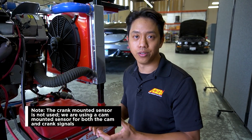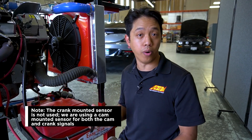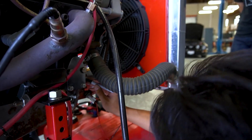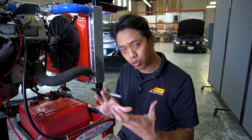One trick I like to use when setting ignition timing on an engine where you can only see a small portion of the crank pulley — making it hard to see where your sync is — is to take a Sharpie, paint pen, white out, whatever, and make additional marks on the crank pulley every 90 degrees. At TDC I'll put one mark, 90 degrees from that two marks, 90 degrees from that three marks. So when you're looking at it with a timing light through a small window, if you see two marks you have an idea of where you are. Whereas without that mark you'd just see a blank pulley and have no idea where you are.